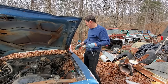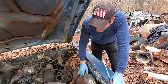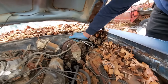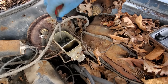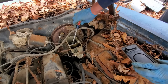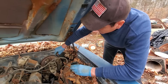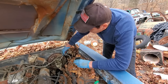One thing I noticed — I was going to check the master cylinder. That's an alternate gas tank right here. So the last time this was run, someone realized that the tank gas was no good. It runs down to the fuel pump, so it's good to know. The master cylinder is bone dry — look at this. Usually it's rust in here, but this isn't rust. This actually might come back — if we put fluid in it, because it's not rusty at all, and I can smell brake fluid. It's just got this weird crystallized stuff in it. We're going to put some brake fluid in this thing.